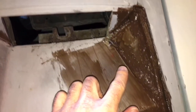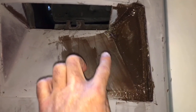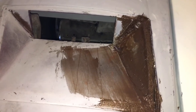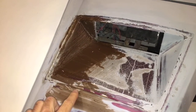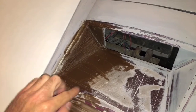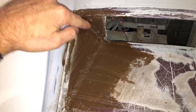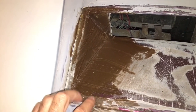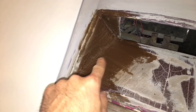Just finished right here - gave the first coat. We're going to go ahead and let that dry real good, and then I'll be back to go over it. You can see there's still a little bit of indentations there because we had to really work it in. Let that dry, then we'll be back to give a top coat and smooth it out real good. After that dries, we'll sand it and prime it. Just finished putting the final coat - you can see here, obviously needs to be sanded still. Everything is all shaped up nicely. We did a couple of coats, sanded in between, and then kept filling it in to build it up to where it needed to be. We're letting this dry now, and then I'll be back to sand it so we can get ready to prime it. You can see how it's looking right in line with the headlights, turning out really nice.